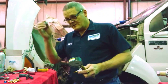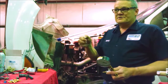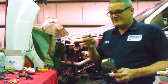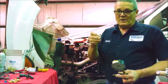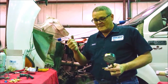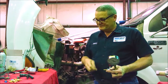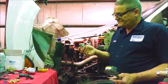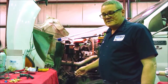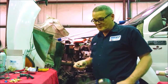On this one, we'd put this on the inlet stud. On a Dodge, you'd put this on the inlet banjo bolt on the VP44. If you don't know which one that is, it's the banjo bolt closest to the firewall — driver's side, closest to the firewall. The front one, closest to the radiator, that's the return fitting. This one has a smaller banjo bolt, so we don't have one made for that; we just go over to the filter housing and grab the inlet pressure.